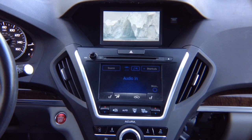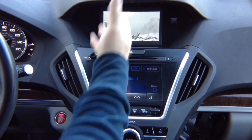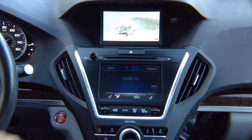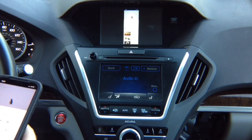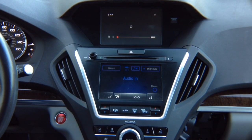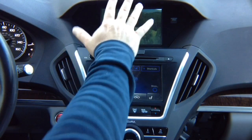Keep in mind: for iPhone X and any iPhone with a notch, when you mirror — even with Apple TV — it will not be full screen. That's how the video looks in mirroring because we're mirroring, not streaming the video. If you zoom in on the video, it fills the screen. For Netflix, though, it's going to be full screen. The video loads and says 'now playing on your TV,' but the video takes up the entire full screen — edge to edge, beautiful HD.